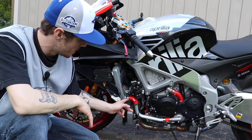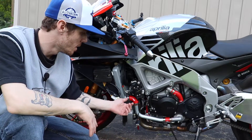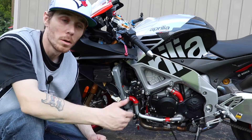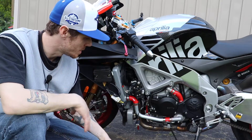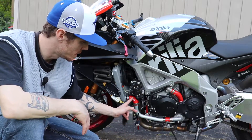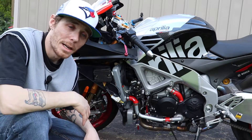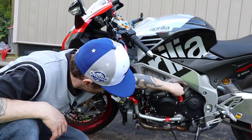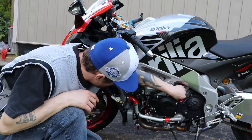I think it looks fresh as fuck. Highly recommend — definitely. The main reason is this was a new bike and there was nothing wrong with the coolant hoses, but over time the rubber ones do kind of wear out and fade. And the one-time-use clamps suck. You can finagle your way and use them maybe two or three times in total, but each time you use them it's not getting that nice snug tight fit. So I upgraded that. I'm pretty happy with it so far. I did have it running — no leaks, nothing like that. Just make sure these are torqued down properly and not too tight because you don't want to mess them up. Really simple, easy as pie.